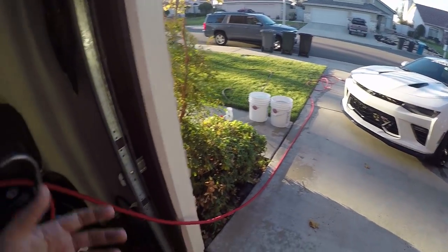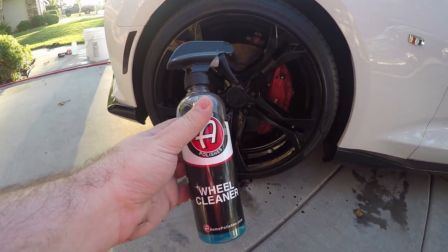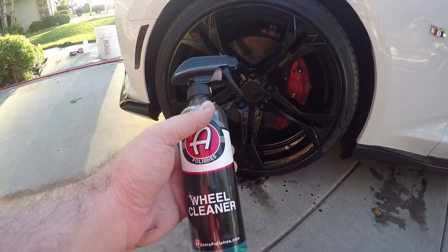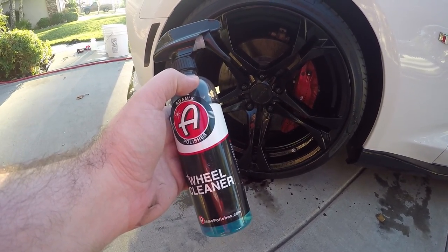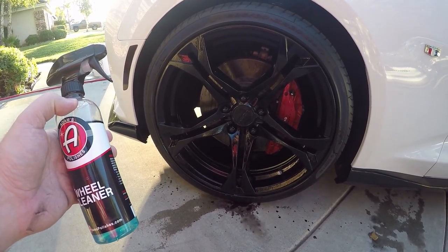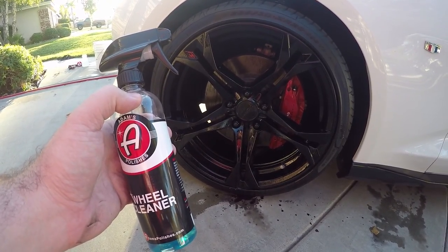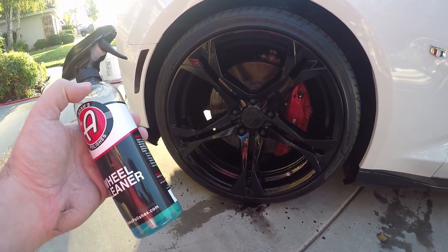One of the main items is a good wheel cleaner. There are a lot on the market and I've tried quite a few. I've personally become a fan of Adams Polishes wheel cleaner. Six, seven, eight months ago it smelled pretty terrible — this one is still pretty bad smelling — but it gets the job done well. I've already sprayed it on this wheel to show you. I spray it on and let it sit for a good five to ten minutes to really let it eat through the dirt, grime, and dust.